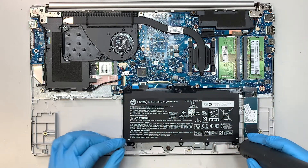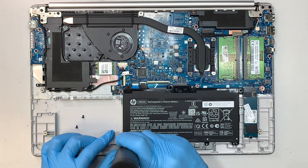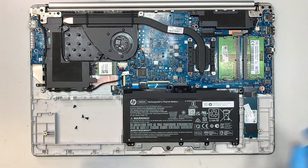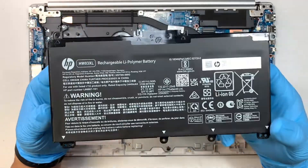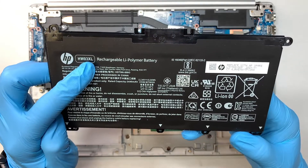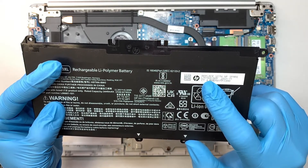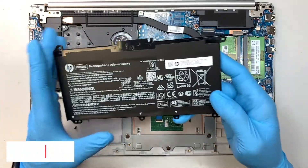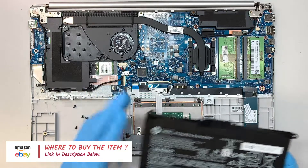Phillips screwdriver again. Once you have removed the four screws, you can simply lift the battery straight up. Now if you are not sure where to find the replacement battery, go ahead and look it up here. If you are not sure where to find the replacement part, the HP part number would be L97300-005. I'm not sure if I can find the replacement at this point because this is quite a brand new laptop, but I will try to link it in the description below.